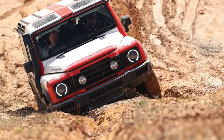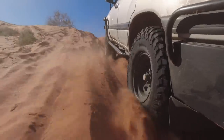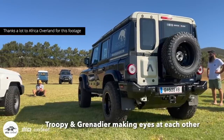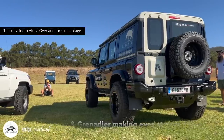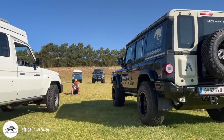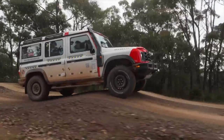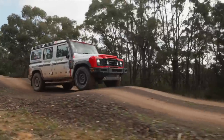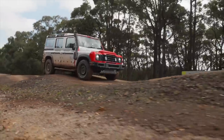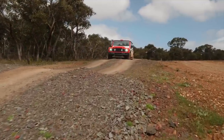I think the underbody of the car will have a lot of contact with the terrain if you're driving in ruts, mud, sand or doing some technical driving. It's a bit of a pity that South Africa had a Grenadier on 35-inch tyres, whereas here in Australia where 33s and 35s are quite common, we only have the stock tyres. However, the clearances are no deal-breaker for me — it's just something to take into consideration and one more reason to at least run 33s, but probably better 35s. I really hope Ineos takes that into consideration and releases a vehicle on 35s, because that would make engineering here in Australia much much easier.